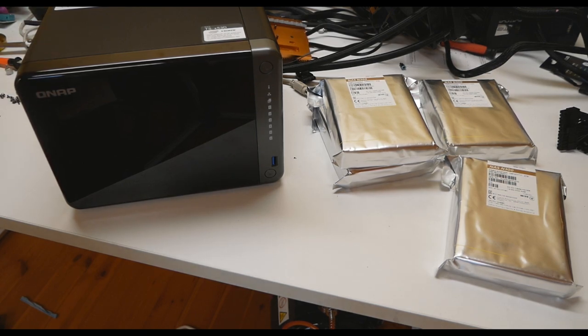Later I could upgrade the drives themselves. For example, to upgrade to 12TB models with RAID 5, you remove one drive — which RAID 5 treats the same as a failed drive — then install the larger model and rebuild the array. You repeat this for each drive. The rebuild process will obviously take a very long time, possibly even a few days, but you can upgrade each individual drive this way.